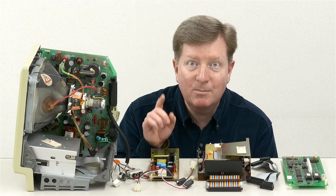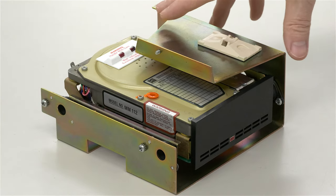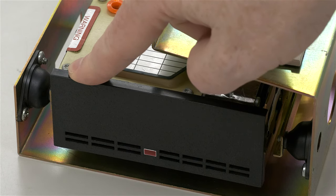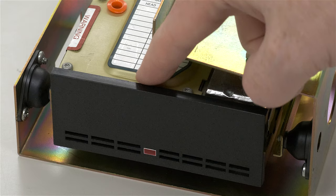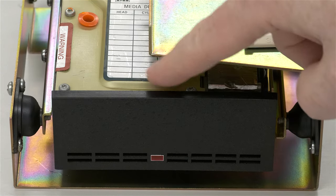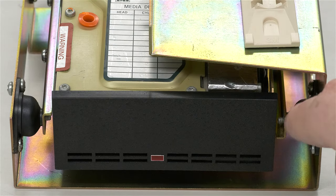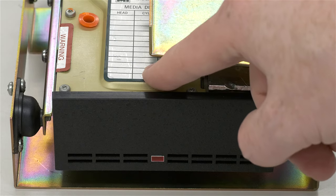Now we're going to look at this kit more closely and see exactly how it installs in the Macintosh 512K. Here is the 10MB drive inside its mounting bracket. There are four rubber vibration dampeners at each side of the drive to ensure it won't be hit by major shocks — important in these early hard drives, as too much shock could easily damage them. These dampeners also lessen the vibration of the spinning drive itself on the Macintosh 512K chassis. Without them, there would be much more vibration throughout the metal chassis.